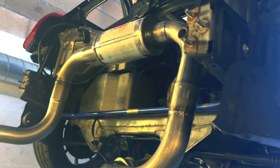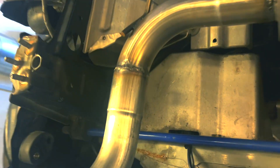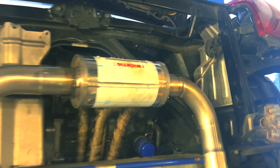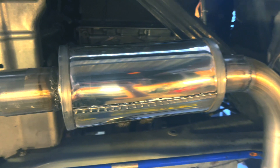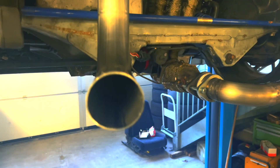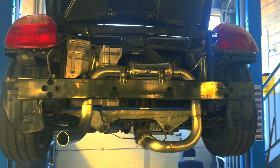As you can see I've already put it together and welded it. I have just one single silencer on it. I am debating whether to put two, but I like the fact that with this design I could reuse the stock brackets and the exhaust does not move, which is really good. In the vertical pipe there would probably be space for another silencer, so that's something I might modify in the future if the car turns out to be too loud. This exhaust - don't look too closely at the welds - has been fabricated by myself. It's the first time I've built an exhaust from scratch, so I'm pretty happy. I wanted a lateral kind of exit so it didn't come out straight, because that would look much less good, so I decided to go a bit sideways.